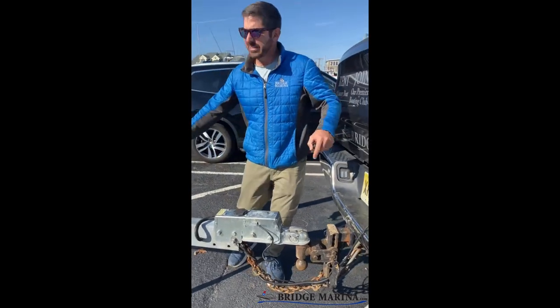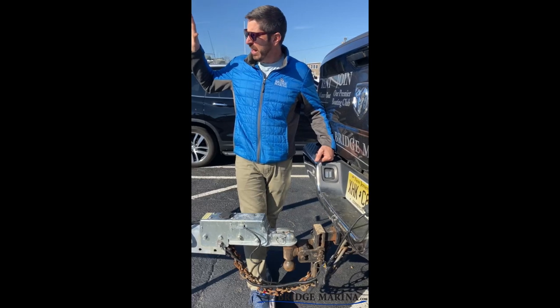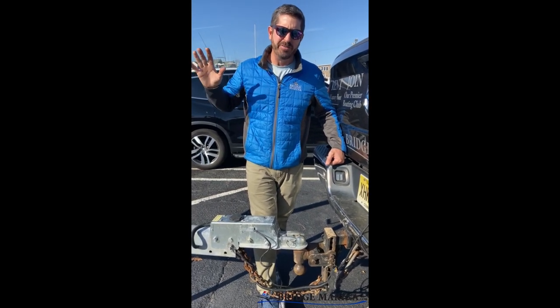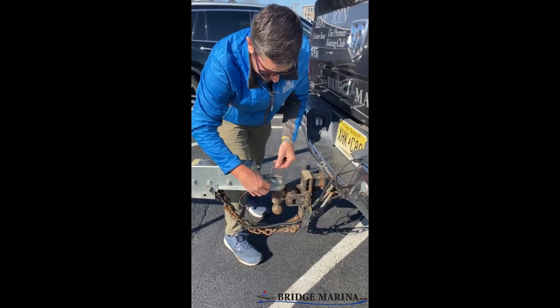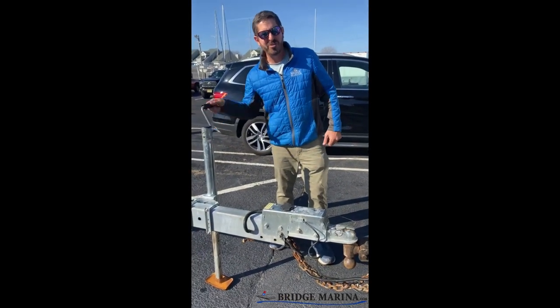After this, I'm going to check my lights, go around my trailer, check my tires, make sure everything's strapped down and my winch isn't loose. I just want to do a general safety check before I get on the road. Finally, to recap: chains, brake, lights, safety coupler — we're ready to hit the road almost. Thanks for watching.